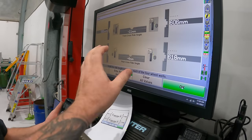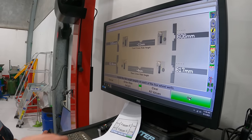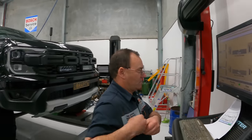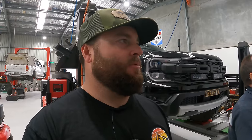We've got a 40mm increase in the front end. With the Raptor suspension, you want to be really careful that you're not lifting the front end too much — depending on the research the boys at CTP have done, as long as that's still within the window of where the bypass ports are going to be inside the shock, then we should be right. But I'm going to have to real-world test this thing this afternoon and we'll see if it's still performing how it should from factory.